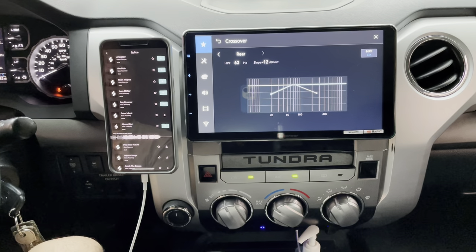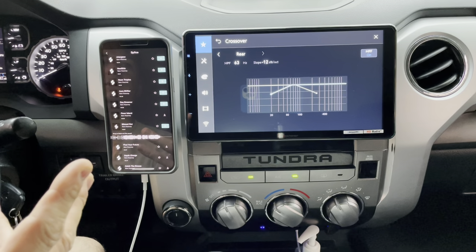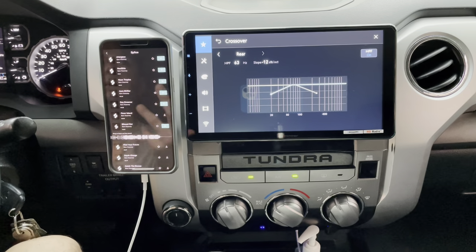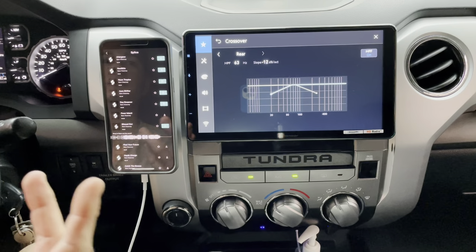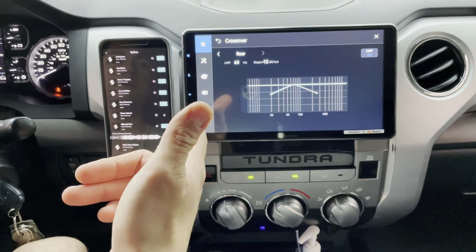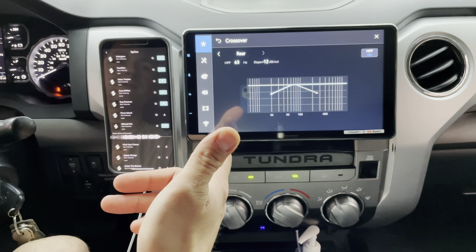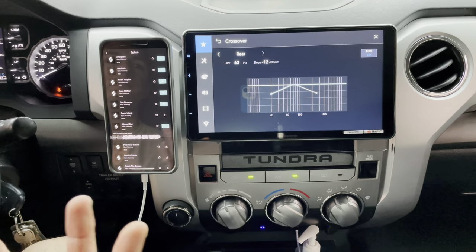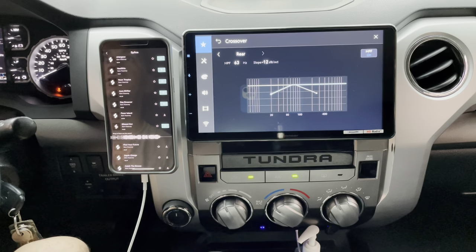One thing I want to note: just because you're using a passive crossover doesn't mean there's a bottom limit to the frequencies. If you have an aftermarket head unit, play with the loudness feature — high, medium, or low, depending on your vehicle, since high can sometimes cause distortion. You definitely have to set the high-pass crossover to create a bottom for the mid-bass. Otherwise it'll keep trying to play as low as possible, and when you turn it up it'll distort, create unwanted heat in your amplifiers, and you could actually end up burning one up or blowing them.